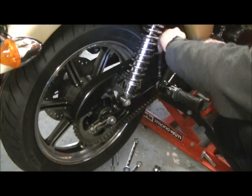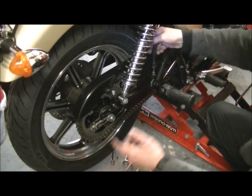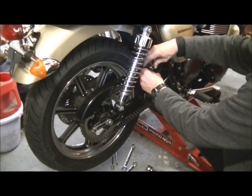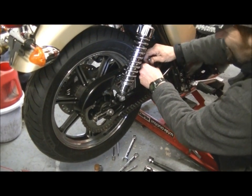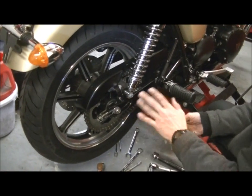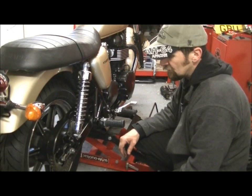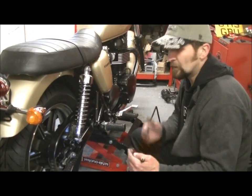Remember, these are Torx drives, but with all these little threads, when you're reinstalling everything, just put a bit of WD-40 or some grease on all the threads, so when it's all buttoned up back together, you've replenished that sort of youthful feel about it, so everything's nice and fresh. If you come to undo it in the future, everything's done. Just do them up hand tight for now, because we're going to readjust everything and then go over every single fastener at the end. Okay, chain guard on, caliper on. Now we've just got to adjust the wheel to its correct length, correct tension and alignment.